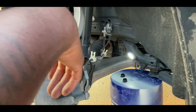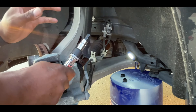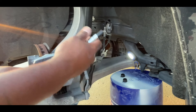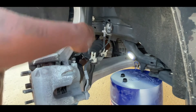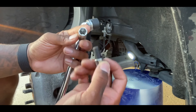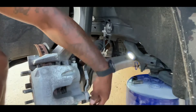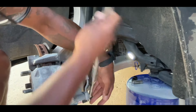I've seen people say these caliper bolts take a 10-millimeter or an 11-millimeter socket. I tested the 10 and it worked, so I didn't need to go pick up an 11, but I will for future use. The bolt fits the 10 millimeter but there's some wiggle room. A 11 millimeter will get rid of that play and give a firmer fit. These are fairly easy to get off since this is a brand new truck with minimal rust.